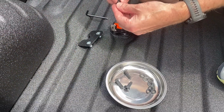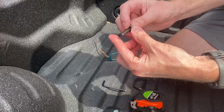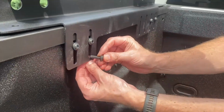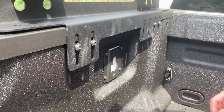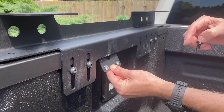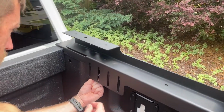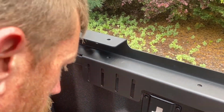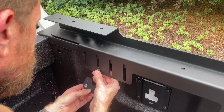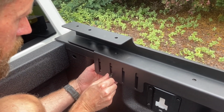And the bolts stack up like this. You've got a bolt, flat washer, through, lock washer or spring washer on the back into this with these nubs, for lack of a better term, facing backward. So over here we would come in like this, get our bolt sitting in there, get our lock washer on the back side, bring it up, and start the process like that.